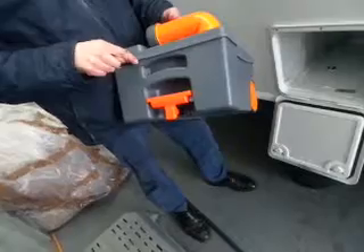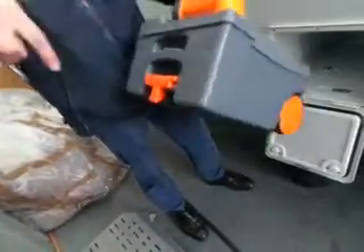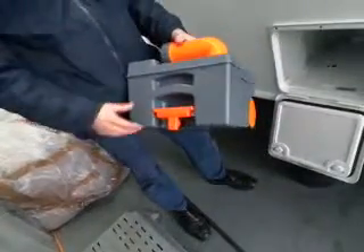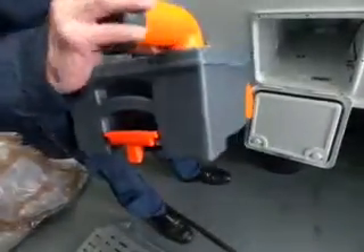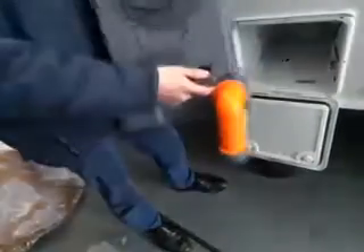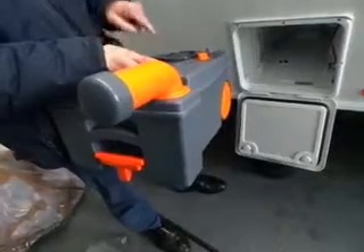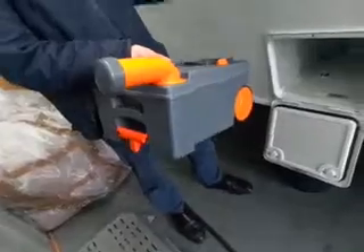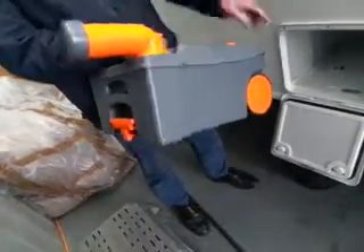The caravan club will have all those facilities pretty close together - the toilet emptying over there, the waste water there. For cleaning this, in between use during the week, all you need to do is just put a bit of water in, slosh it around and empty it back out again. Don't crash it around because there's a float inside there that indicates the level when the cassette is full on your toilet system. If that drops out down the empty point, you're not going to be fishing around getting that back out and it won't tell you the level.